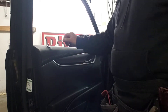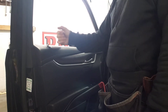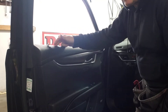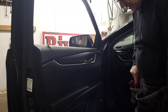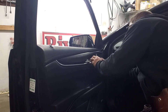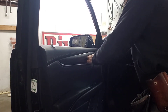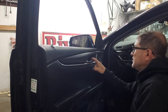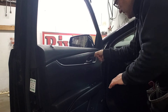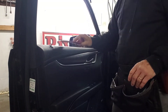This is a Cadillac XTS 2020. If you want to bottom load without the sweep, you don't need to remove any screws. Although if you feel the need, there is a cap — this little cap over here — that hides a seven millimeter bolt. It's very easy to access right there. But to be honest, I don't even remove that. There's plenty of room to remove this sweep without removing anything else.